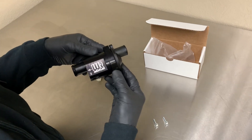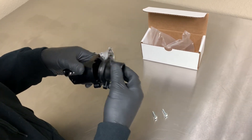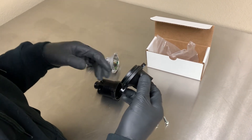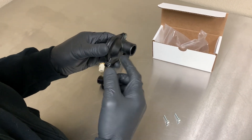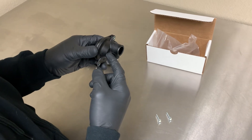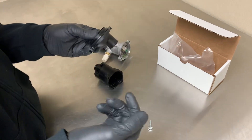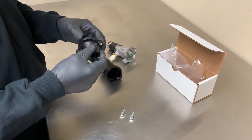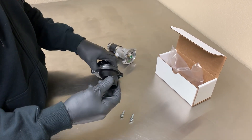So you want it facing like that. Make sure the O-ring doesn't get pinched. This cap is like a hard plastic and we've seen problems with them either warping or eroding. So we do make a billet housing cap also — it's part number 10026 — and also the O-ring. O-ring wise, you're good to use the stock one as long as it's in good shape. If you want to get an O-ring from us, it's part number 10112.